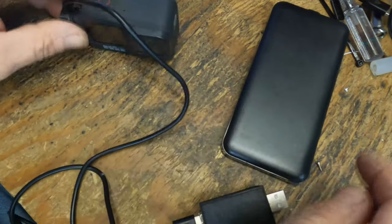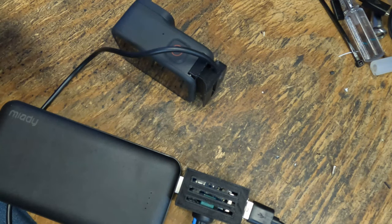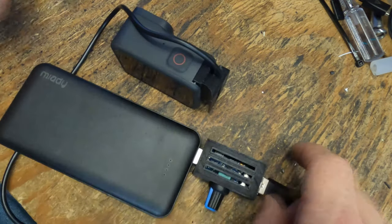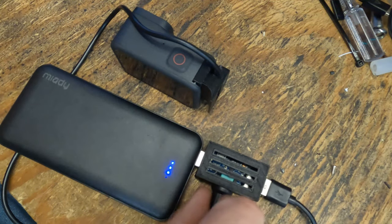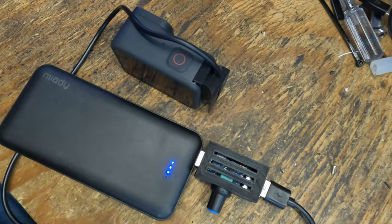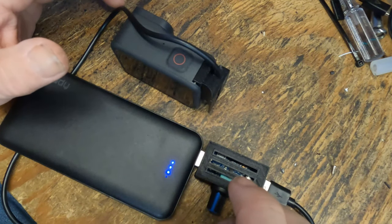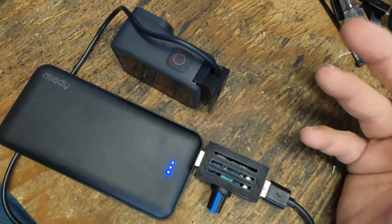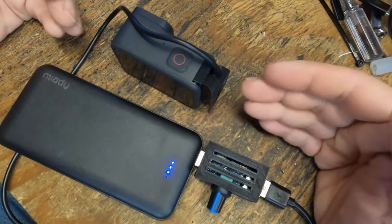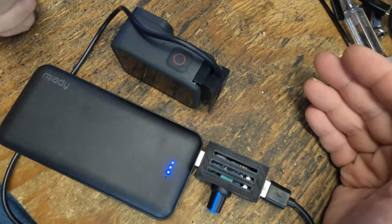So what can it do and what can't it do? Obviously at high speed the audio here is not usable — in fact the audio in the whole room becomes unusable. So definitely we can't cool at high speed. The idea behind using these is you're going to have to source audio from somewhere else, or you can use this in situations where audio doesn't matter. If audio doesn't matter you can record 5K with this — turn the fan up to the 5-volt setting and it'll run probably under 120 degrees the whole time it's on.